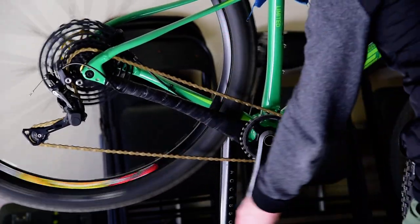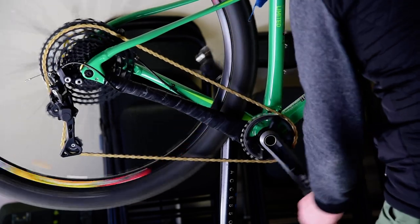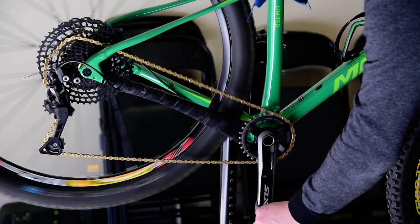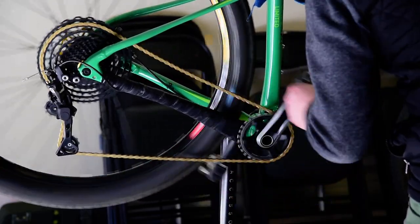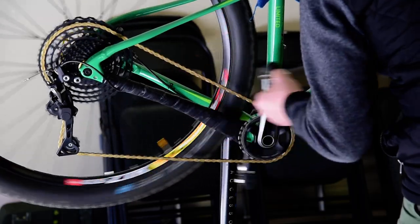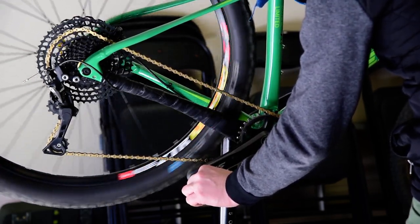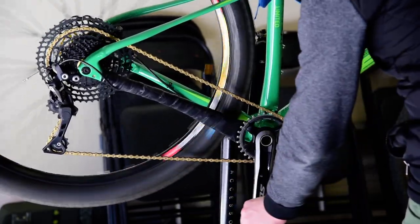Taking all the tension off and we're back on again. Back-pedaling again — forward, then trying to get the strong leg back for a manual — completely off. If you need to go again, we're jammed at three-quarters of a turn. That's on the 50 tooth. Quarter turn on the 42 and we're off. Moving down to the 36 — almost a half turn but we're starting to come off at the quarter turn mark and then completely off. Dropping down to the last of the aluminium sprockets — and we're actually holding there.